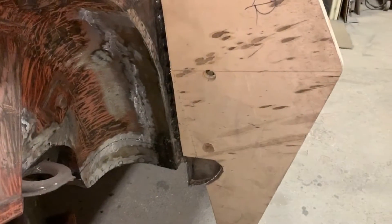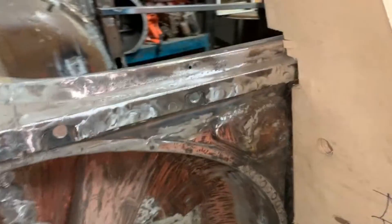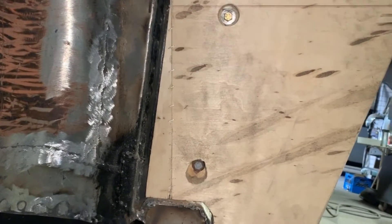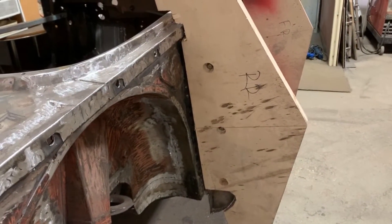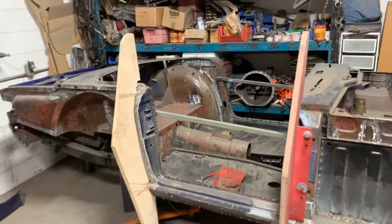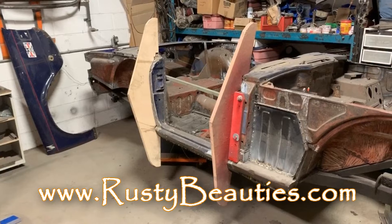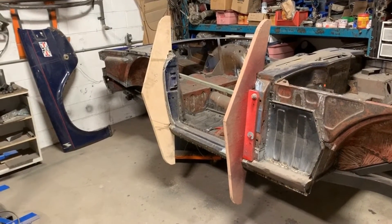It's mounted with three screws for the fender. The back of the B-post here is a brand new aftermarket piece I mounted, and for some reason I had to make this hole oval and bring it a little bit lower, and the bottom hole I needed to oval too and bring it a little bit higher. The center matches. These holes as they were originally matched the '70 TR6 I worked on, but here it's a little bit different.